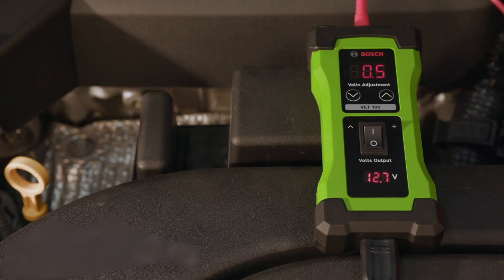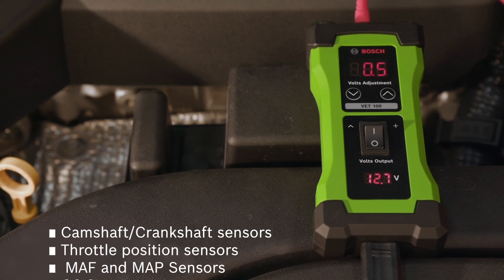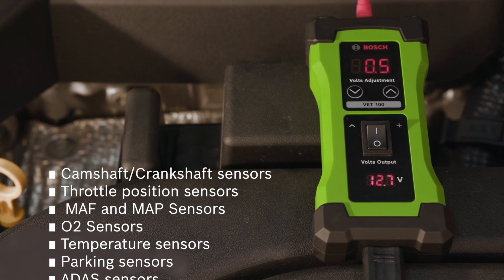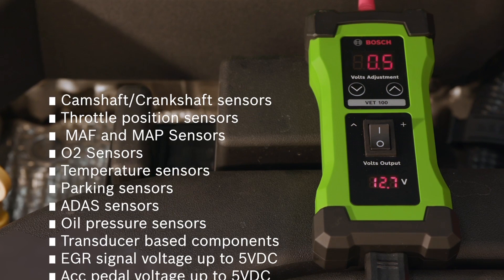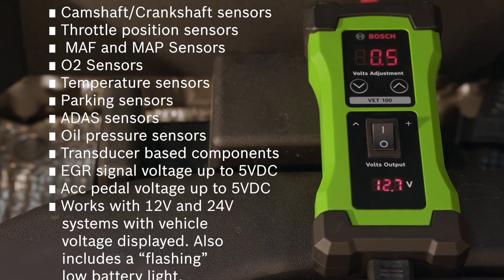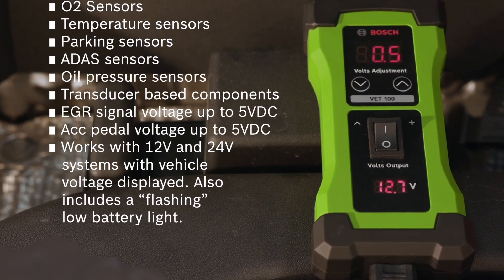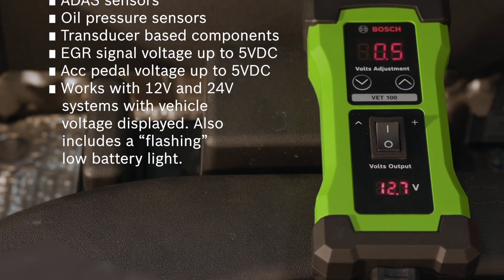The tool can be used on any sensor that uses a 5 volt reference. Here are some examples of sensors you can test. We can test the MAP sensor signal return circuit to determine if this circuit's integrity is good and the controller is reading the input to make proper changes in fuel delivery. You can also test the O2 sensor to ensure that the signal return circuit is feeding the controller the proper voltage for fuel control as well as catalyst function. After seeing this list, you can tell we can test just about any sensor talking to any controller.